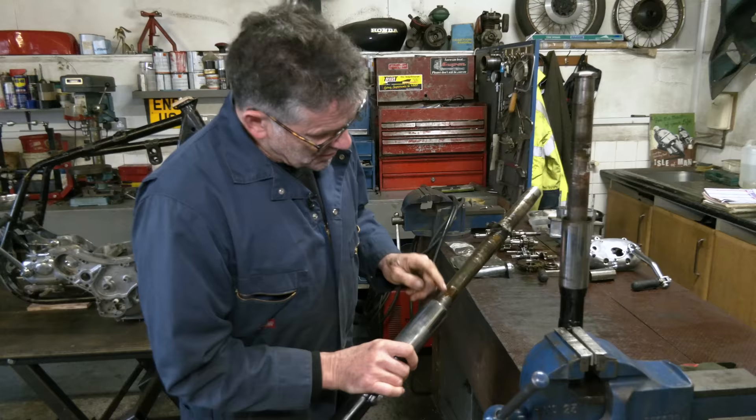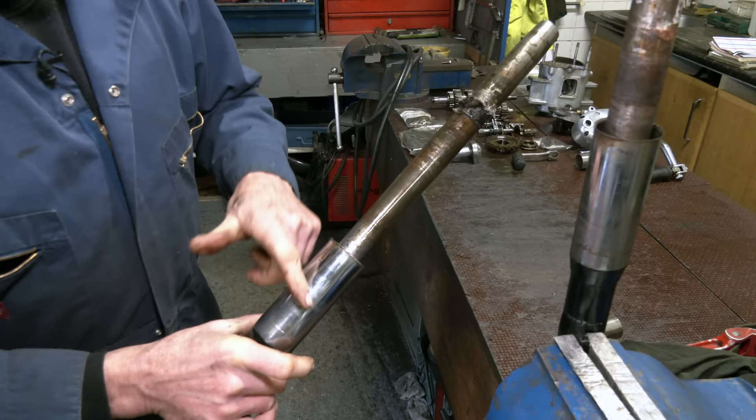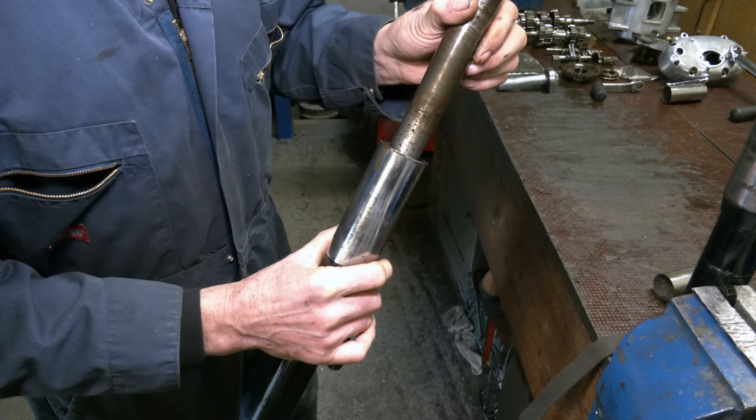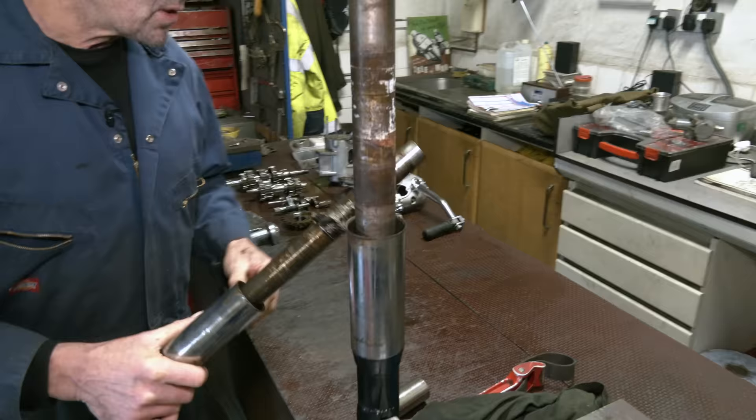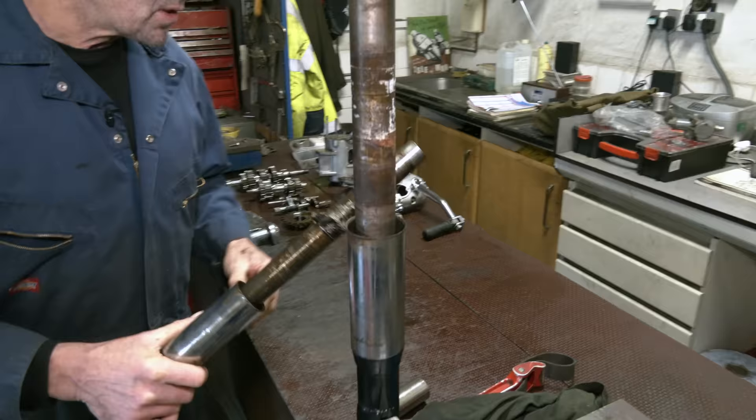Like we were doing a few weeks ago with Thomas's A10 Golden Flash — I can't get the seal holders undone easily. We're going to have to have new ones because I've put a strap wrench on and they won't come undone, so it's going to be a little bit more work to get those apart. We've put new staunchions in with new bushes. These are relatively cheap — we paid £120 for a set of staunchions, which is pretty good value. So new bushes, new staunchions.